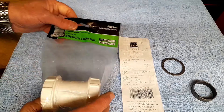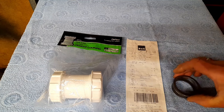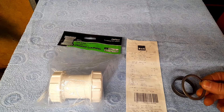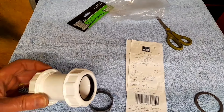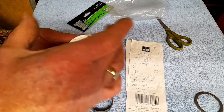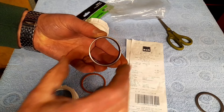I have two fork seal drivers, and although they're great for putting in the actual fork seals, they won't put in this top bush. I know that you could slide this washer spacer over the top and drive this bush in using that, but I don't want to do that because I don't want the edge to scratch the inside or the coating on my fork tubes. So I bought this here, which I think will do the job.